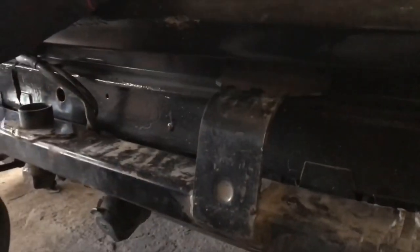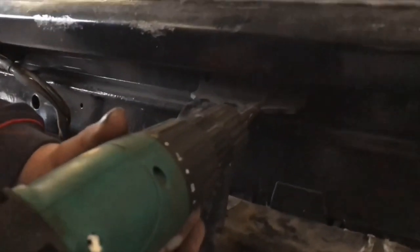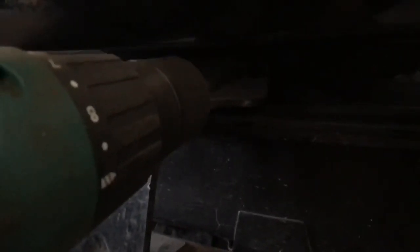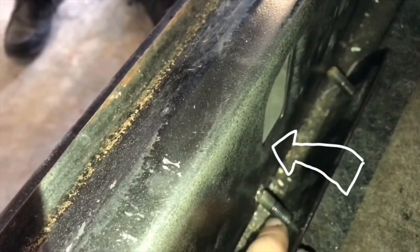You'll need to mark out where your mounting points meet the body and drill the mounting points out. Your kit should come with a flat piece of metal with two threaded bars on each one. These go into the inside of your boot and you bolt it up from the outside once you have drilled a hole big enough to accept the two threaded screws. That plate goes in from the inside and you bolt it from the outside.